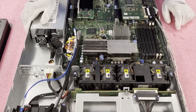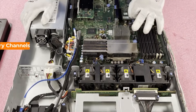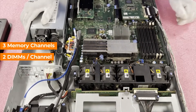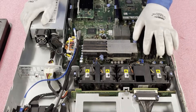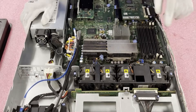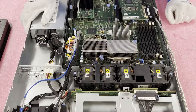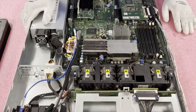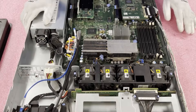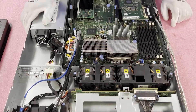As we discussed, there are six DIMM slots inside — three memory channels with two DIMMs per memory channel. This is the start of channel one, channel two, and channel three. If you were only going to put in three DIMMs, that is the proper way to install them. But for a machine this old, there's no point — you need to put in six 4GB modules and max this thing out at 24GBs.